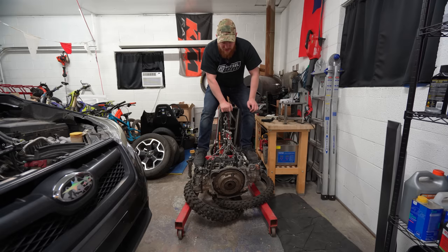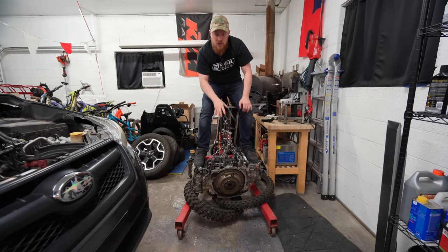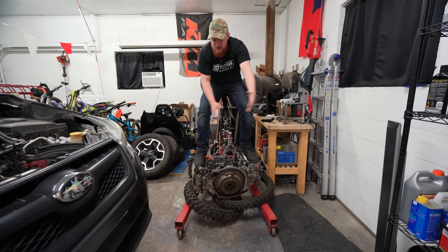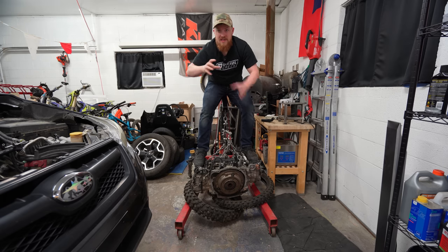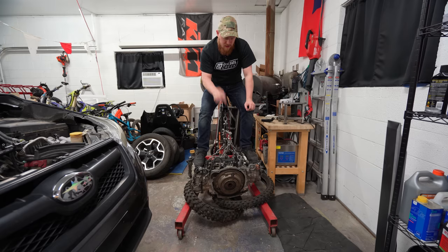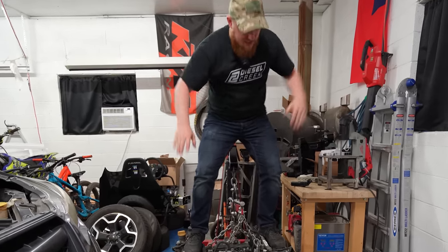And actually, I'm probably going to pull off the clutch before we put it on the engine stand, because of one of the issues our Crosstrek had. It's really weird, but essentially when the clutch was warm and I would start slipping the clutch to get going, which I had to do because the Crosstrek has no power, so you have to slip the clutch quite a bit to get going at all, there would start to be oscillations. I think it was the whole drivetrain going cha-cha-cha-cha, the whole motor and everything. I think it's maybe uneven wear on the clutch, and I have no idea how old this clutch is. So if we're going to rebuild the motor, I'm going to put on a new clutch because we're already this far in. So let's pull the clutch off and start working on it.